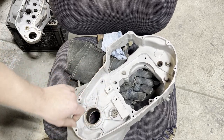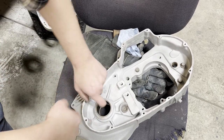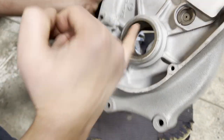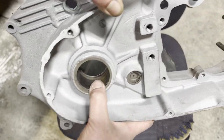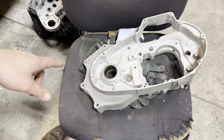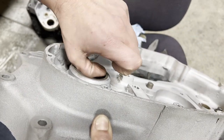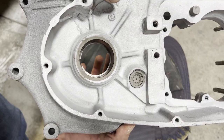Basically I'm going to take the new race and press it into this until it hits this snap ring area. When I prepped the cases these have all been through the degrease tank a ton of times — wiped everything out, cleared all the passages. Make sure the two oil passages for the feed or the drains that come through this bearing are completely free of debris, especially if this case got sandblasted or coated. You do not want sand and grime from blasting to go into that center Timken bearing. The lower snap ring is in, which is really what I was waiting on — now I can press the race back in.